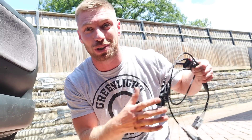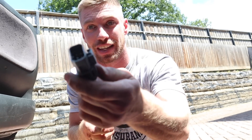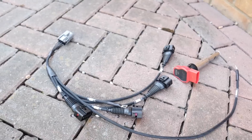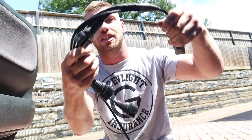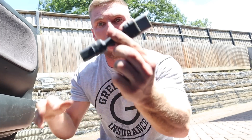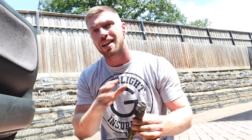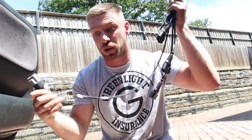How am I going to get an S13 to run coil packs from an Audi R8? There's a company called Boss Wiring on Instagram and they make personalised looms for absolutely anything. So here I've got a personalised loom — that's the S13 CA18 one and then it goes to four Audi R8 coil pack plugs. It's nicely heat-shrinked, looks beautiful. We've got the ground and also an igniter bypass. You have so many igniter problems with these cars — they're so brittle, if you go over a big bump they break and the car won't start. With this bypass, the coil packs are strong enough to go straight coil-on-plug.